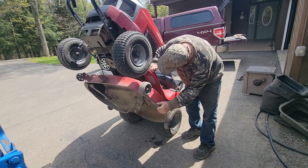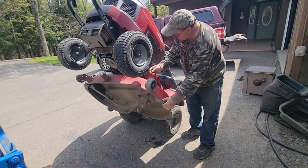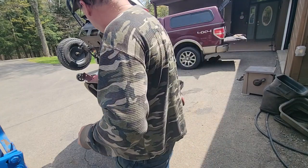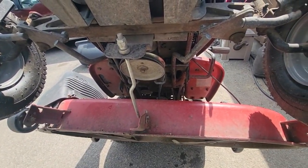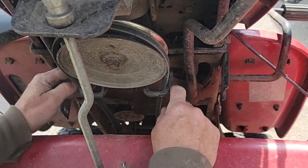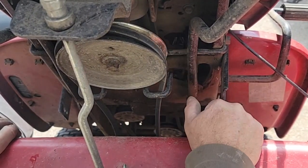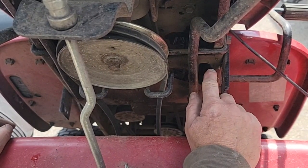Okay, so there's two right here, then there's this cable. I'm not sure I have to take the whole deck off to do that drive belt. Let me show you — get down in here. This is the deck belt, then straight up it's the drive belt. Right now it feels pretty tight, but it was slipping going up the hill. I tried to back up — we got a steep bank out front and it wouldn't even move. And it looks like there's some wear on it.